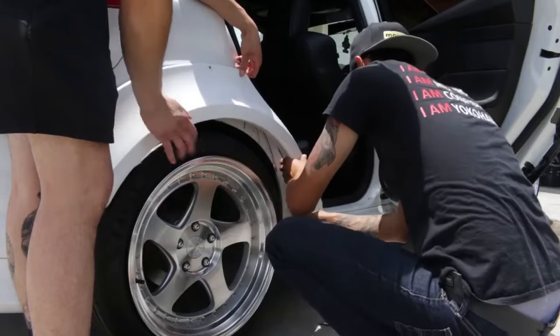It's time, baby. Time to start cutting. All right, we got the first metal sheet cut and pulled off. Now all we have is the inner rear well liner. So we're gonna create our stress cuts in here, and fold it up, and then cut them off and grind them so that they fit, so it seals it and the water doesn't get in there. Right, Alec? Yeah, you know, water's bad.